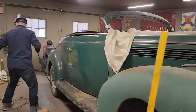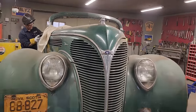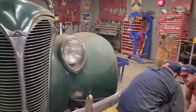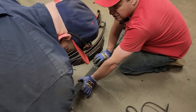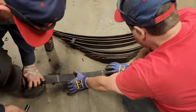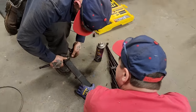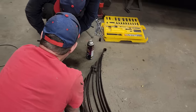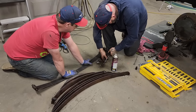I put new ones in my car, man, because the bolts broke off. You had to burn them out. Or, you know, if you've got a really nice fancy drill bit, you can buzz in around them or something. I had to burn them out with a torch. You know what that's like. Great burn, dirty and stinky.